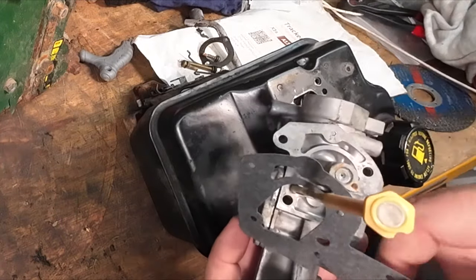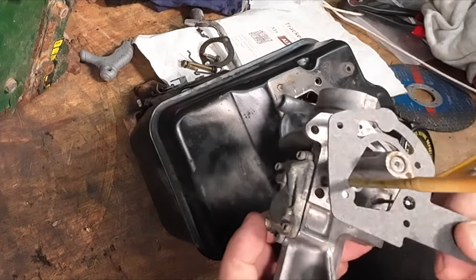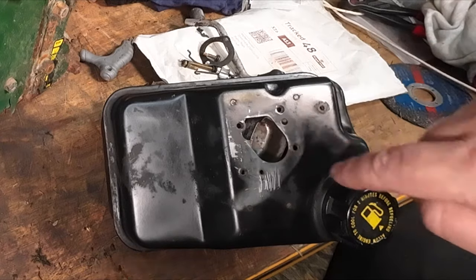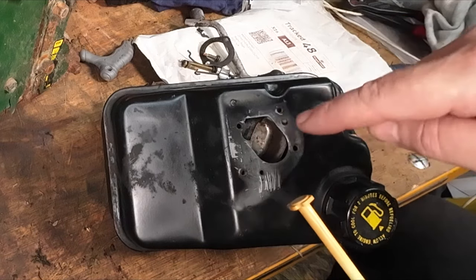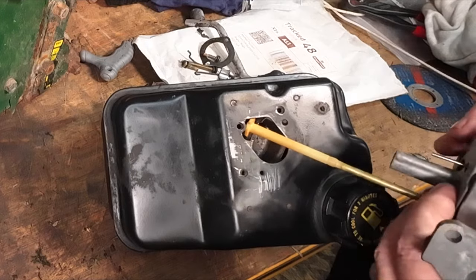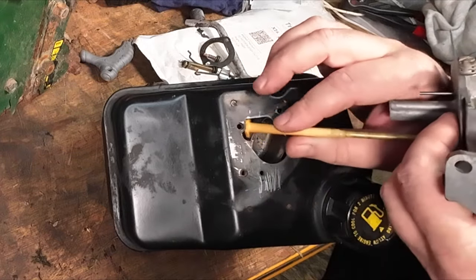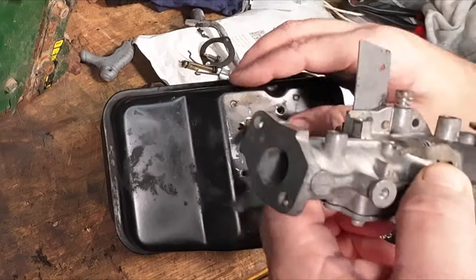You've got this channel here — that channel there obviously is corresponding to that channel there, which goes like that. So the carburetor will sit just like that. And now the straw: you've got a little tiny well here, this well doesn't go very deep, and that's where this part of the emulsion tube housing goes. And then this hole here is where the straw goes — this big pickup straw. So that's got to go in; it's a bit of a tight fit but it'll go. You don't want to force that because it will break on you, and then you're in trouble.